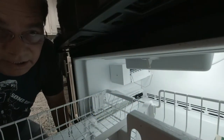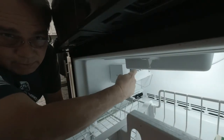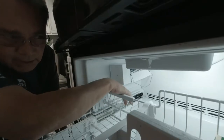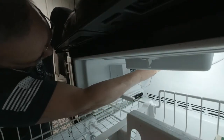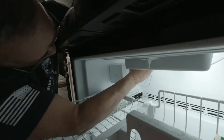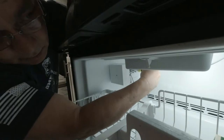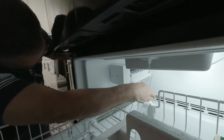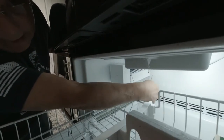We've got a couple of quarter-inch screws that we've got to loosen on the top, and we've got to take one out that's on the bottom. The ones on the top we just need to loosen up. I've got my quarter-inch nut driver. I just want to loosen those — just enough so we can lift it off of the little keepers — and then the one on the bottom has to come completely out.